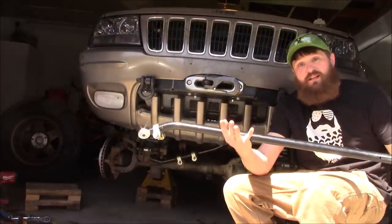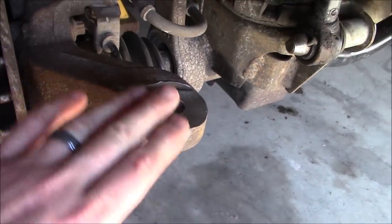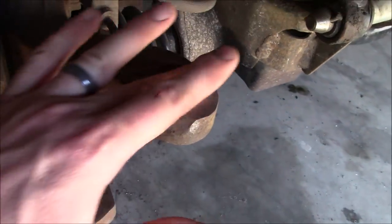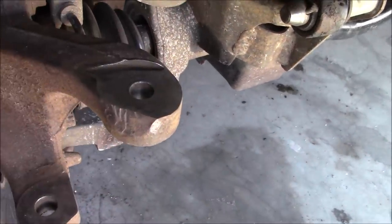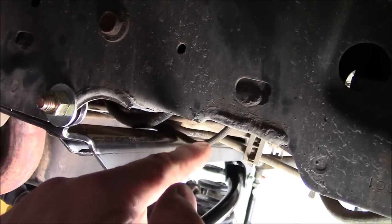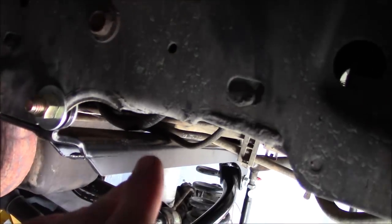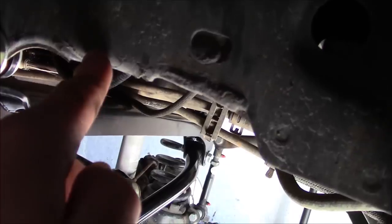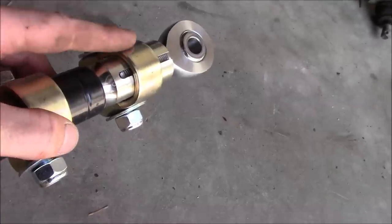Now that the track bar is all installed, we're moving on to installing the drag link. Before we get started, there are a couple things to address. Since this is now going to be installing to the top side of the knuckles, the instructions suggest that you take a file and make sure these are nice and flat. I just took a hand file and some sandpaper and made sure everything was nice and smooth for a flat surface so the heim joints will sit flush on top. Also, right here on the uniframe channel there is a piece that hangs down with a pinch weld — you can't cut it — but to clear for the drag link, the instructions suggest that you bend it down. I just clamped vice grips onto it, bent it, and pounded it with a hammer to get enough clearance.